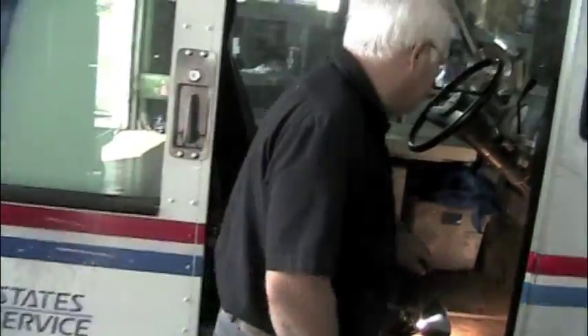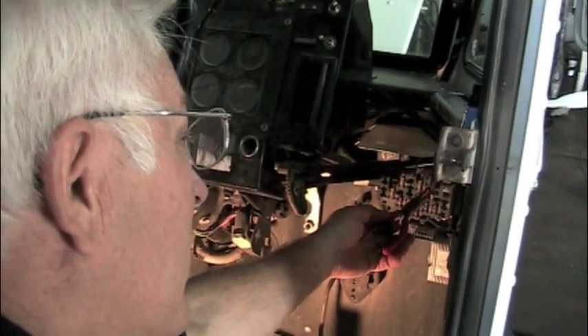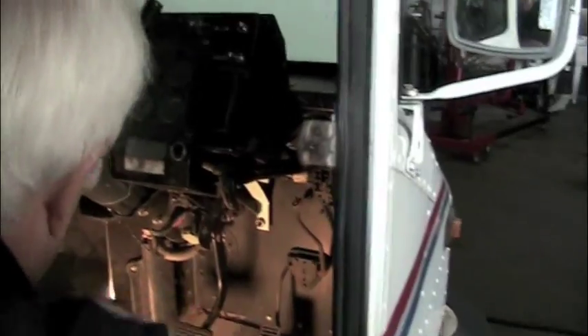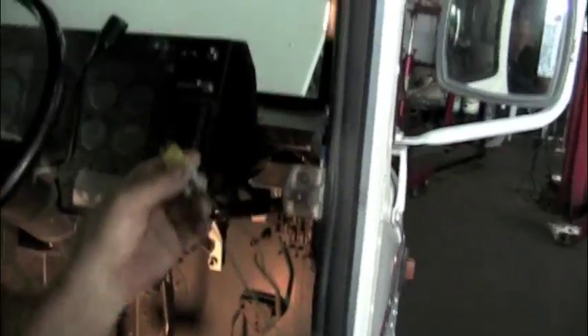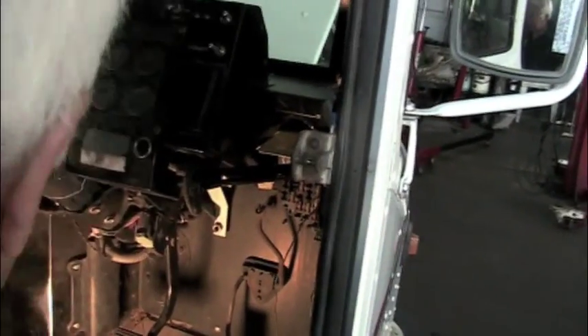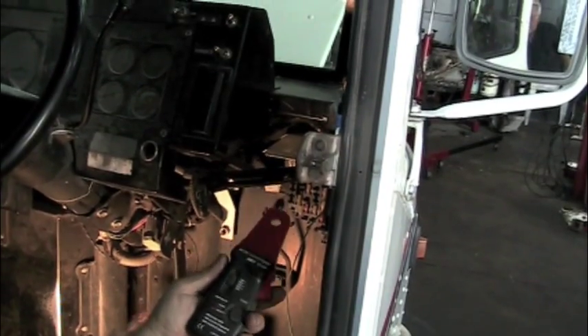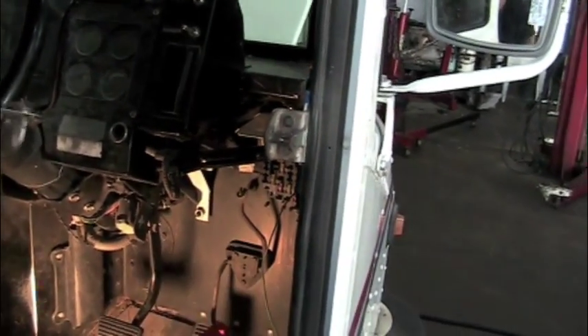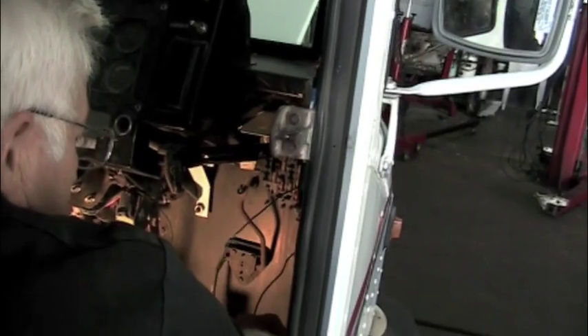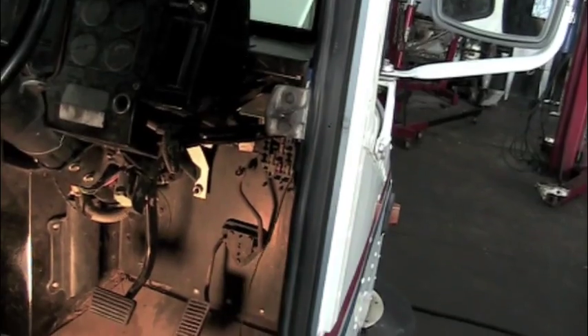To do that, I'll show you what I do. On an LLV, I come in here and take the ECMB fuse out. I made myself just a jumper wire — I plug that into the ECMB fuse. Take my generic current probe, set it on 20 amps, hook it around the wire, so we can see an electrical picture of that fuel pump.